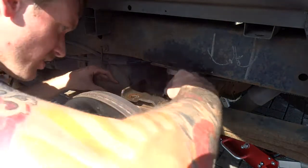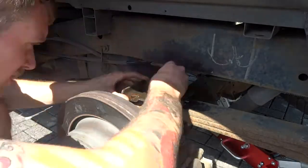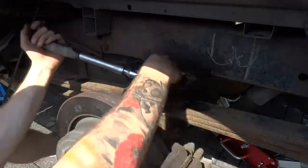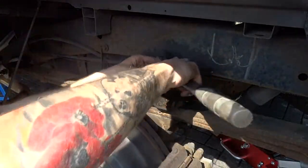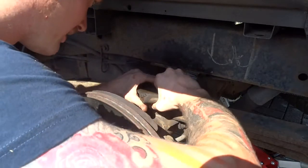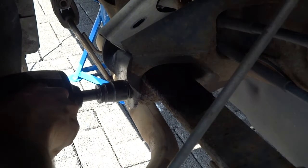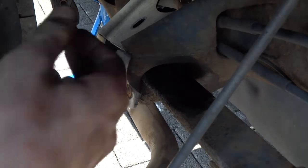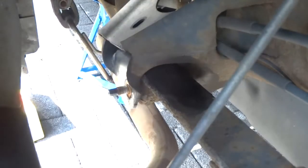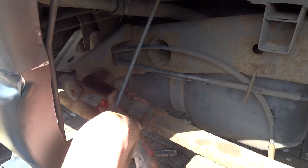Once the wheel's off and you've got it all jacked up — make sure it's on axle stands, chocked at the front — you have to remove the U-bolts, which as far as I remember are 22 millimetres. This is the generic same thing across the board. Different sizes yes, but every single leaf spring will have U-bolts onto the axle — that is just how the system works. You'll see me undoing the U-bolts here; surprisingly not that tight, so I'm kind of glad I'm going around and servicing this thing.